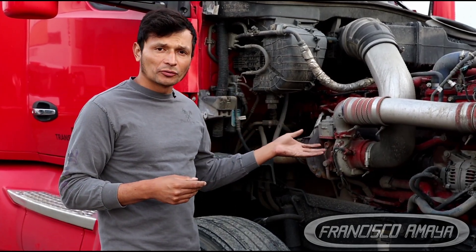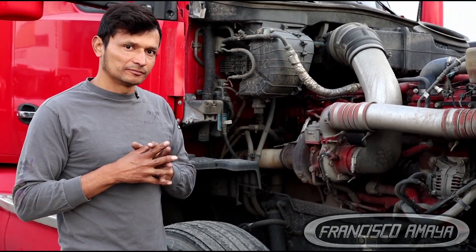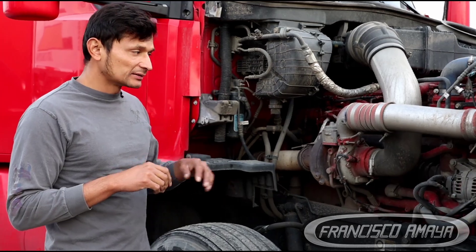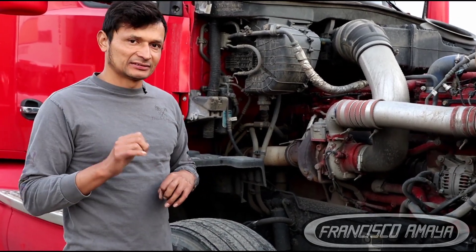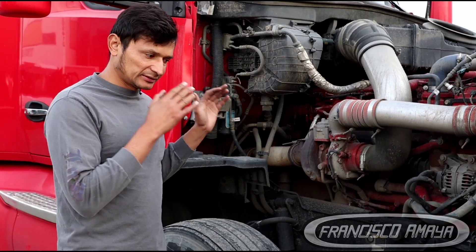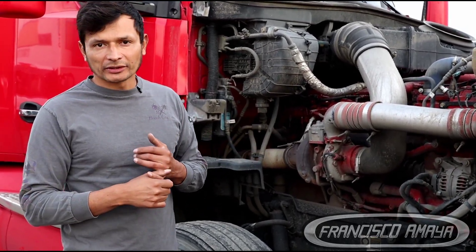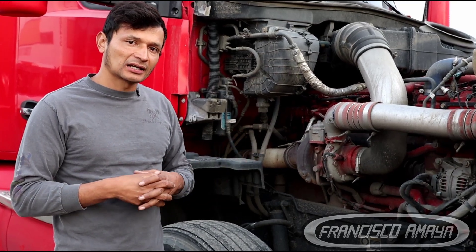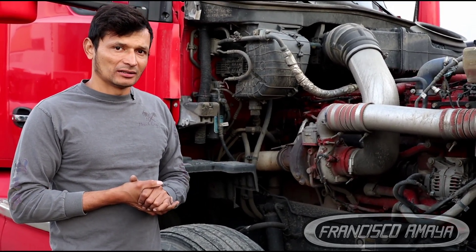This is just a conversation about it — I wanted to do a little video talking about the problems you can get on a Cummins ISX or X-15 when you are missing coolant. It is just three simple problems, but they are very hard to find if you don't know how to look for them. It is very important that if you get any type of issue where the engine is missing coolant, you repair it as fast as possible. If you continue driving your truck in that condition, it can become a much bigger problem later and cause damage to emission components or the engine internally, because coolant cannot be compressed. If coolant goes inside the combustion chamber, it can destroy your engine.